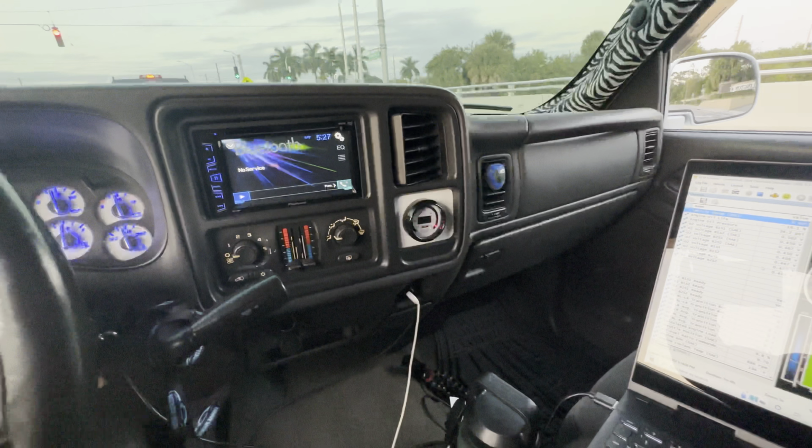One other way you can figure out your exact tire height is this unit conversion. You can put in what you need up here and it'll spit out a number here. So if I do 295, 55, 15, 27.8, you put that in here and it updates it for you. And now we can go test this out.